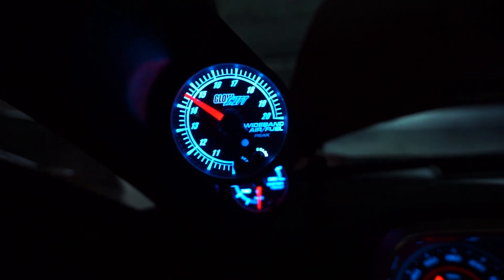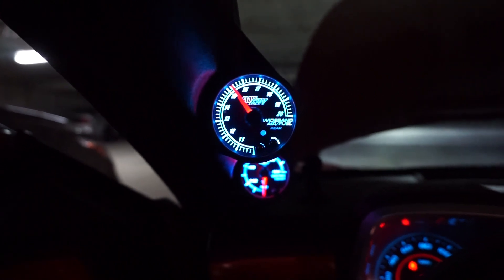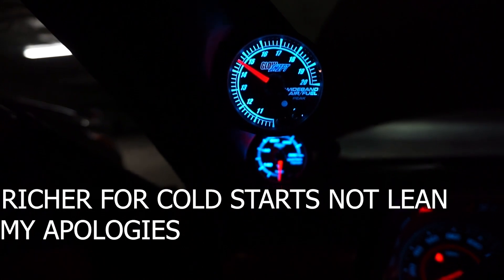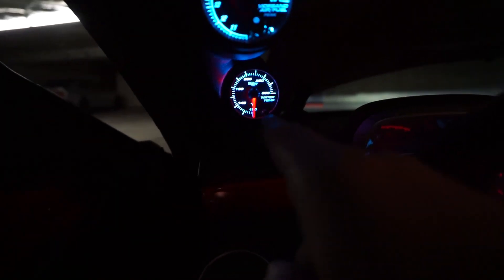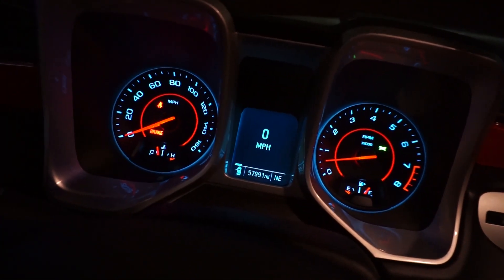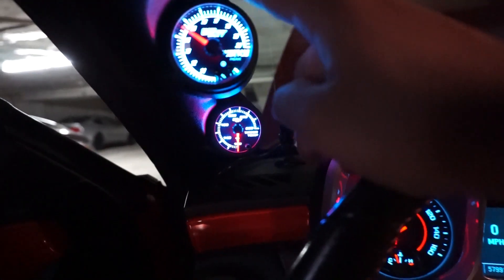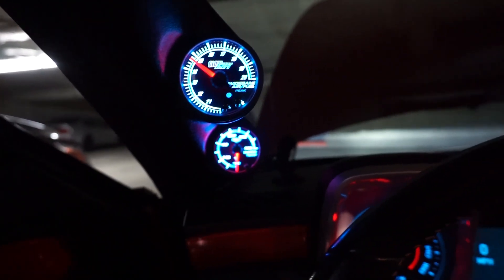If I give it a little gas the needle jumps up and down, but the gauge is working — which is the point and I'm super stoked about it. From a cold start you might get a leaner number initially and that's okay, the car is just starting up. The water temp gauge has to be at 180 — the car has to reach 180 — and it looks like it's already at 180, so that temperature gauge should start going up. That's what the air-fuel ratio gauge looks like and that's how you calibrate it, on a 2012 Camaro V6.